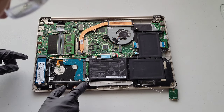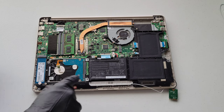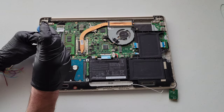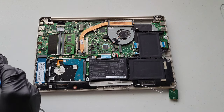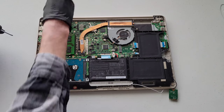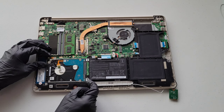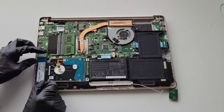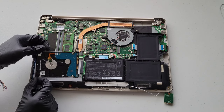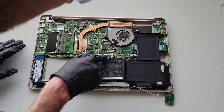To get the battery out, I'm going to take this piece off and set it to the side. We need to remove the hard drive because there is a plastic clip on this side of the battery that goes underneath the metal part from the hard drive case. There's a screw here for the hard drive — the ones I'm taking out now are a different length. Then we'll gently lift the hard drive, pull it back, disconnect it, and set it to the side. Now we have access to the battery.